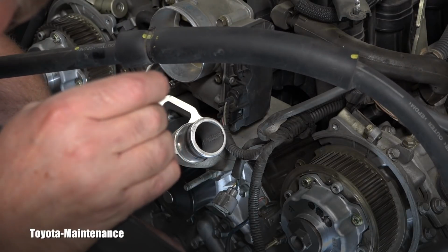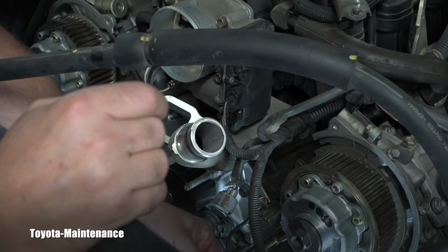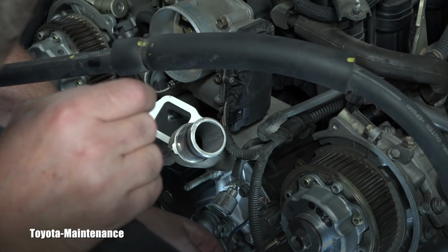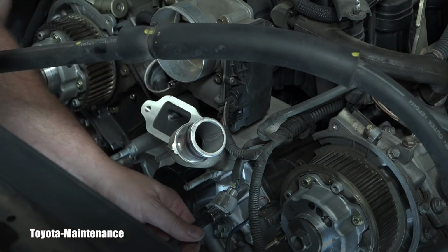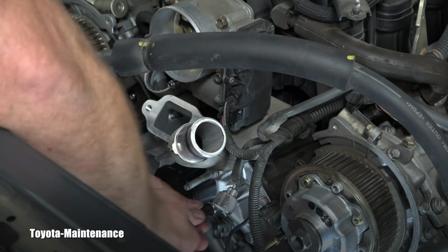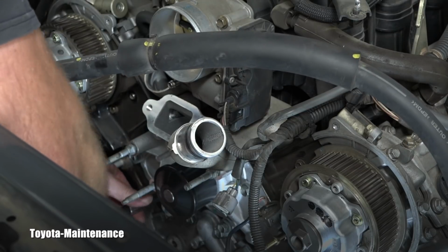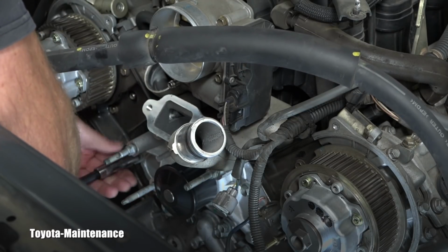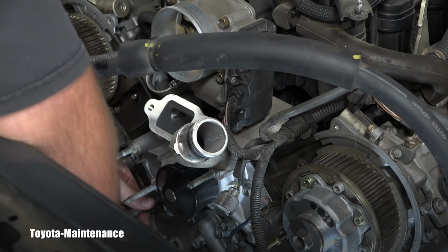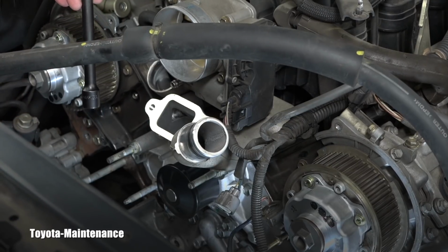I'm going crisscross, excuse me. I'm trying to seat that pump evenly on that gasket. Also, what I didn't mention, there was an O-ring on one of those pipes, so that was replaced, right? That's a new one. And I'm trying to put it nicely, evenly back right now. I did all of them by hand. I can't move it anymore. It's evenly seated. Time for the torque wrench.